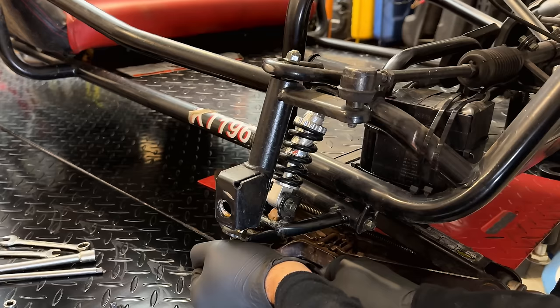And the intake, yeah, definitely not a 4. Let's try a 3. And a 3 fits. So we're at 3 and 5. I'd say we're a little tight on both valves. But let me just double check.